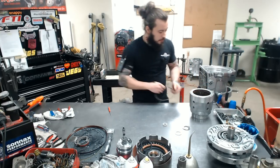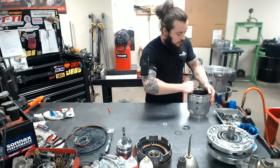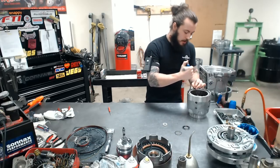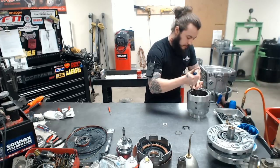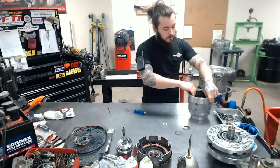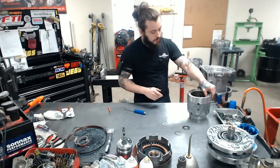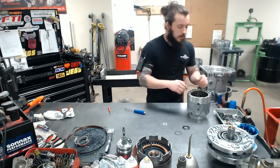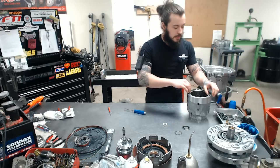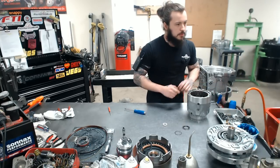And then we'll just set our apply plate up and place your gap on one of the cages, again preventing any flick of a tab off the drum and a serious failure. A little TLC: making sure the spring cages move, your clutches, everything is pushed back against the drum. That way, when you're spinning it at, well, not hundreds of thousands of RPM, but you know what I mean, nothing is going to grind into each other. These clutches are extremely sensitive.